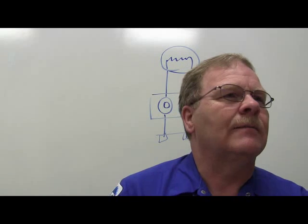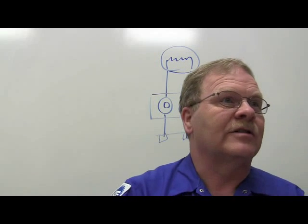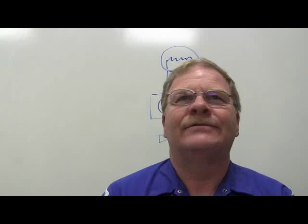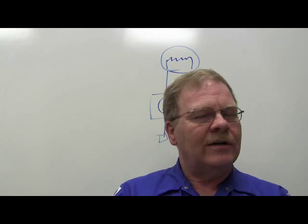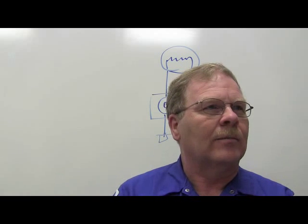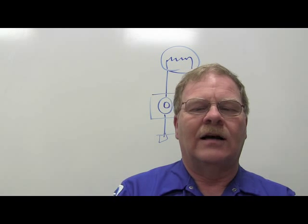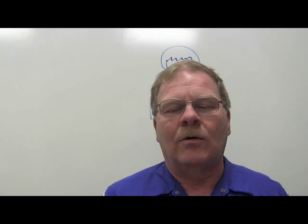An 89 Taurus comes in. When the rental car places had 89 Tauruses before the dealership did, because they buy so many from Ford. Okay, one comes in for this guy, with like 6,000-8,000 miles on it, something like that. And when you crank that thing up cold, you'd have to really feather the gas to keep it alive. And if you didn't manage to keep it alive, it would foul the spark plug. So you had to take the plugs out and clean them, put them back together, crank it up. You keep it running, and that son of a gun, when it would idle, a little bit of white smoke would come out the tailpipe.